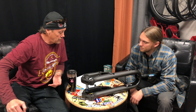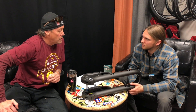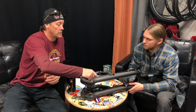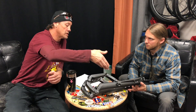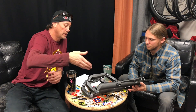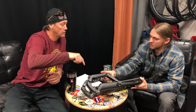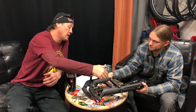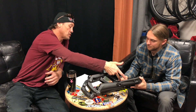The anti-dive effect comes from the control link here having somewhat of a horizontal component — it resists the braking force. As the wheel spins, it's not going to want to move the link in that direction. I noticed when I grabbed the front brake it didn't dive as much. That effect could even be enhanced by making the control link more horizontal or changing the position of that link.